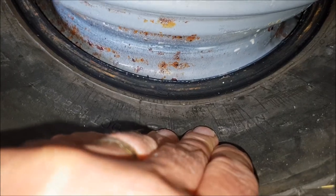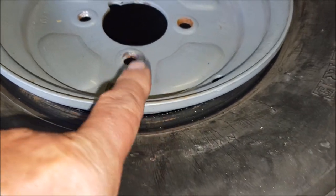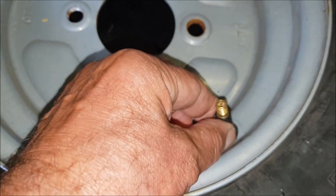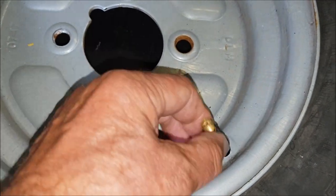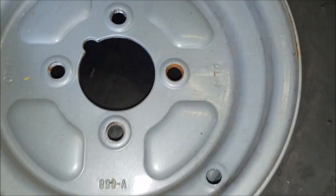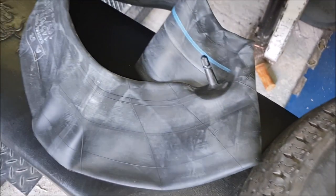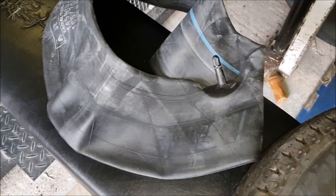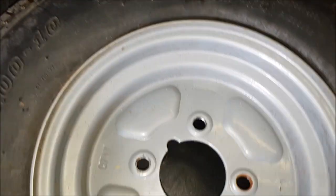What I want to do is pull the tire over the rim. I've let all the air out, then got a knife and cut off the valve, and popped the other bit inside. I've got a new inner tube off eBay, seven quid delivered, so I'll throw the old tubeless setup away.